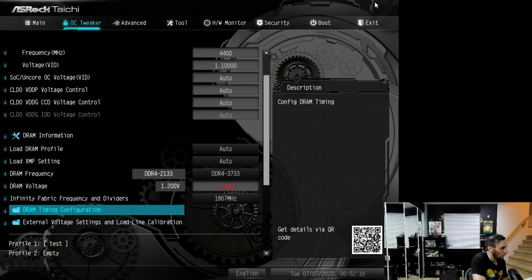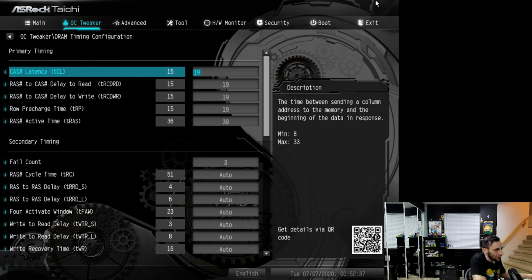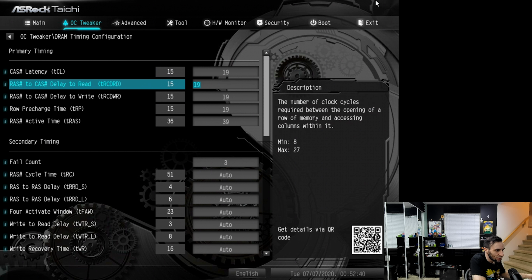So then what do you do next? Well, you found your max core clock, which was your first step. You found max core clock at the lowest voltage you can. Next, you're going to find your max memory speed and your highest fabric clock. And the reason why you set your initial timings to whatever is on your sticks, unless, okay, hang on, let me go back and change that sentence for a second. You put whatever is on your sticks if the sticks are higher than 3800 or 3733. If you have 3000 sticks, then that's going to be a little tricky to overclock.